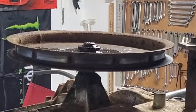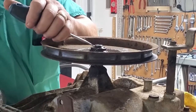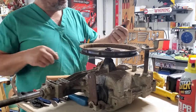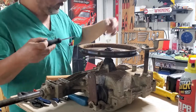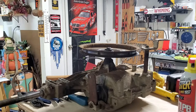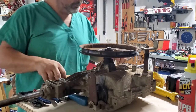Sorry about the light. One side broke off because it's just rusted — I'll get it out. I got new ones, so I'm just going to knock the rest out. It doesn't hurt if you peck on a screwdriver lightly, but don't be wailing on it because it will explode in your hand. If you're going to do anything more than a light tap, get yourself some punches or chisels. There's another piece and there's what's left of it.